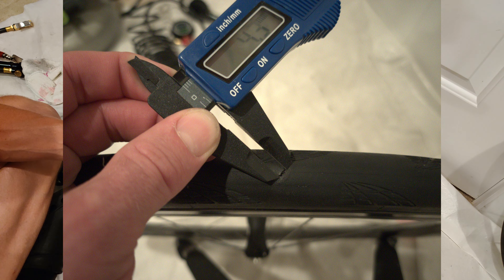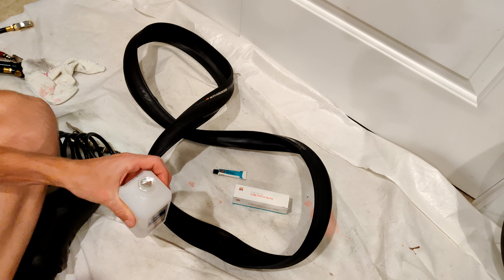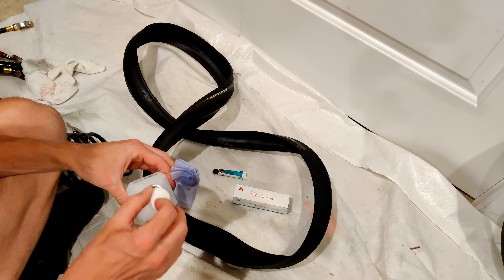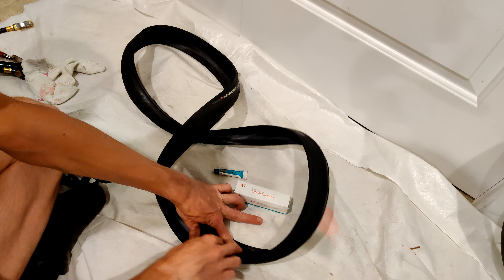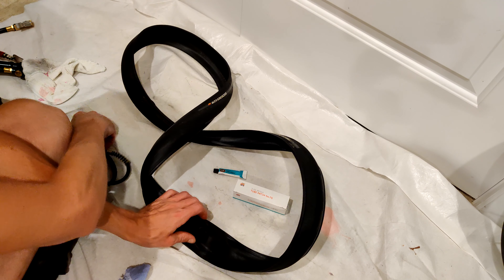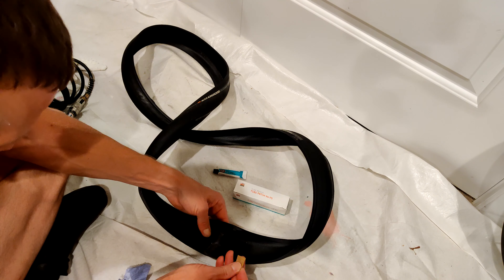The hole cut is about 4.3 millimeters. Like I said, I'm going to try with a standard tube patch. First, clean it with some alcohol. I took all the tubeless sealant out and cleaned it up using water, but I'm going to try to clean it first with alcohol, just to make sure I get all the sealant out. The sealant did work when the puncture happened.